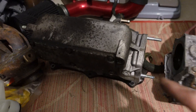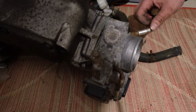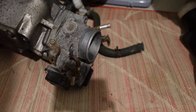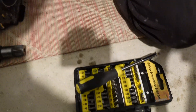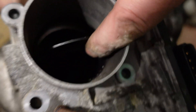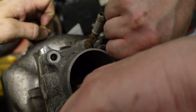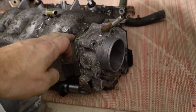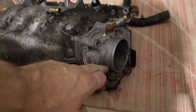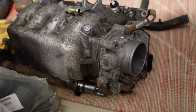So that's the FN2 throttle body, and that's the EP3. To me, that looks like it fits fine — same bolt spacing. Is that the throttle body on the right way around? Let's open that up and look inside. It's lined up... it's slightly off on the top. It's just got a little bit of misalignment — the bottom and the top are both slightly open. So the top's slightly out of line. But if that's out of line with this one, when we put the EP3 one on, the bottom would be out of line instead. It must be just a fraction lower. So it does fit, though.